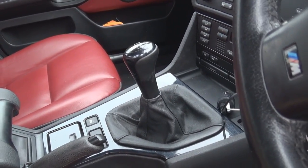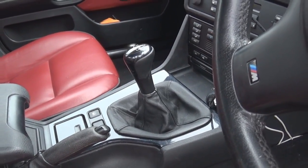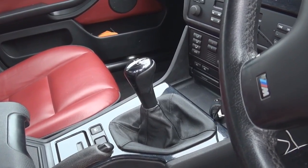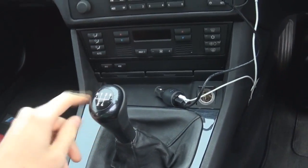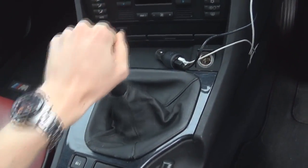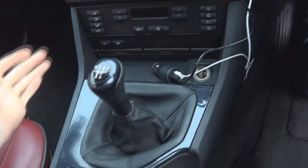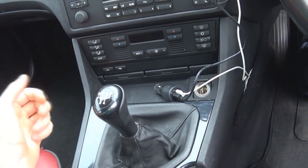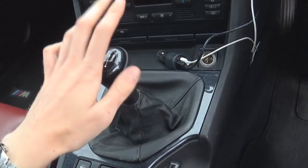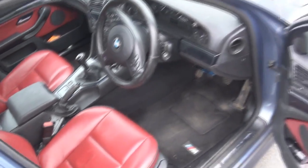Other than the sheep, it was a really nice drive up the mountains. This short shifter makes a big difference — trying to go up and down the gears with a long throw is possible but it's just not anywhere near as quick as this. The only thing with this shifter is it does appear to be a little bit notchy, especially when cold. I think it just needs to be worn in, so it might get better. If it doesn't, then I might just need to get new gearbox oil — 155k miles, I think I changed the gearbox oil about 20k ago, it might need changing again with a better quality oil. A nice little upgrade, and thanks for watching. I hope you enjoyed it and I shall see you next time.